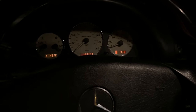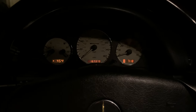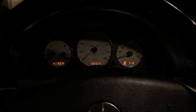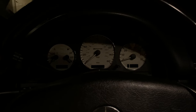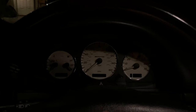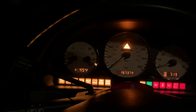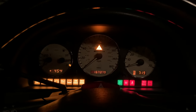Unexpected video to be making right now, something I'm kind of confused about. Hopefully people watching can chime in. Basically, the ML55 for whatever reason, when we go over a really hard set of bumps - normal bumps that typical cars handle with no issue - any abrupt hard bumps like that, the car will throw a bunch of warning lights: the BAS, ESP, and check engine light. Basically almost every light on the left side will come on when I go over those bumps.